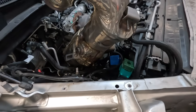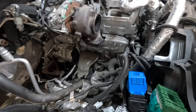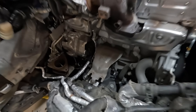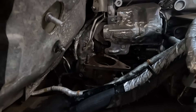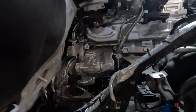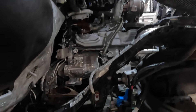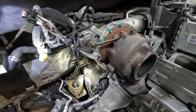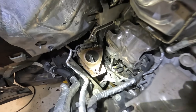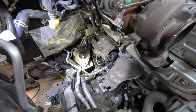This shows the arrangement the DPF came out in, and here's the bracket it was resting on. Here's the back pressure valve — just showing the engine bay area and the amount of room now that it's removed. Down through the fender well, just going over the right side of the engine block. Here's our back pressure valve that will open and close based on needs from the ECM commanding it.